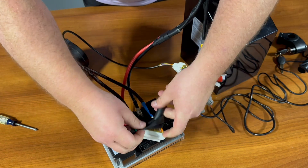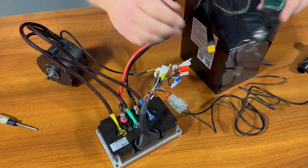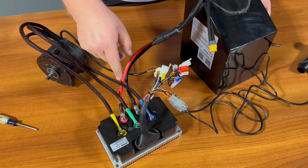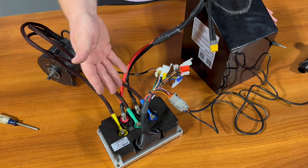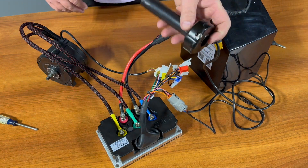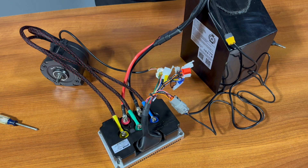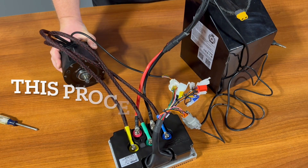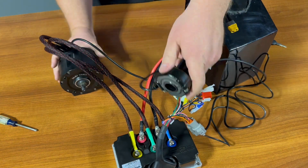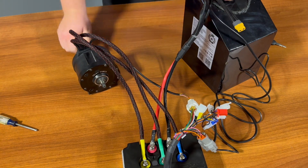You've got to be careful with this — there's a lot of pins here. We've got that in. Now let's go ahead and flip our key on and see if we've got power. You can see that we do have power — we're at 82 volts. If you hear the controller beeping, that means it's in self-learning mode because this is a brand-new controller. To complete the self-learn, take your throttle, hold it wide open, and the motor will go forward and backwards until it finds its place, then give another beep telling you the auto-learn is complete. That last beep is the confirmation that the self-learn is complete. Let's give it a couple revs — you can see it's got plenty of power. Probably have to do a little better tuning on that, but you can see that we have everything set up.